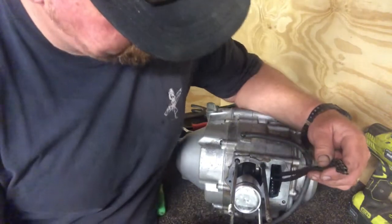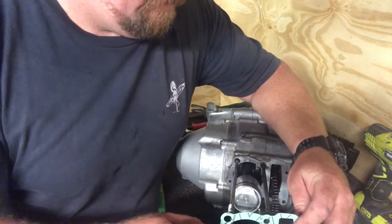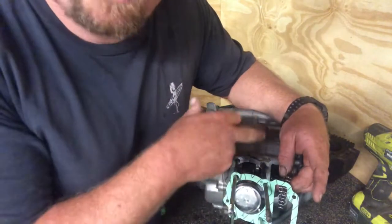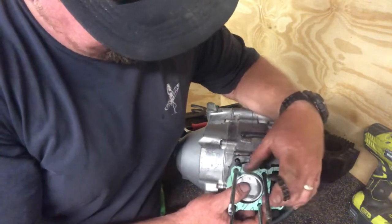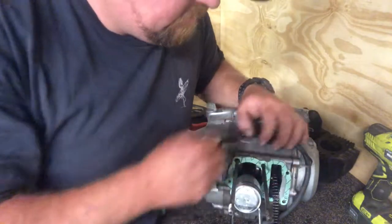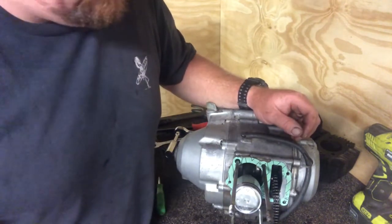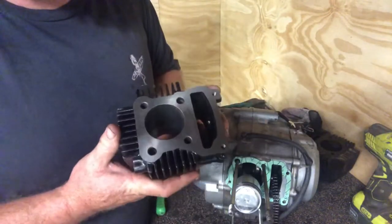The cam chain is going to be a little bit in the way, but I'll show you how to do it with it there because you don't always have to take all of this apart. You will have to retime it, but you don't have to take the chain out if it's not worn. Just gently lifting everything through the gasket so we don't damage it. All these surfaces where the gaskets go have been cleaned up with a razor blade to remove old gasket bits, and then a polishing mill on the drill just to clean them up so you get a nice good seal.